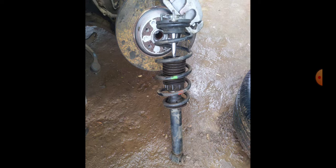Thicker springs generally push the car up, but it's still not a guarantee. For example, there's the 406 V6 saloon and the 406 V6 coupe. If you take the coupe spring and put it on the saloon, it will drop the car much lower — because the coupe spring is designed to be shorter, meant to give the coupe a lower ground clearance than the saloon and station wagon. The same applies to the 407 V6 coupe versus saloon.